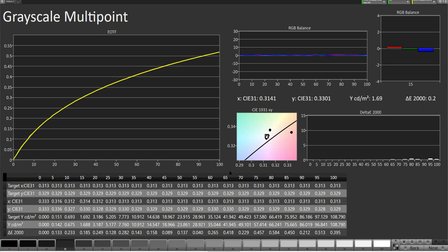Starting from 65 we get 0.4, and 0.5 here — but again it's a really good result. There's not much more to explain on the grayscale. I calibrated in gamma 2.2 for the gaming mode because with games I like to see the details in the darker grayscale, especially if you're playing online and you miss something in a darker area. The result is really great.